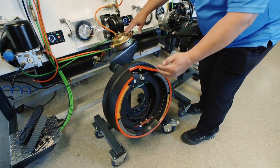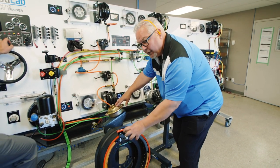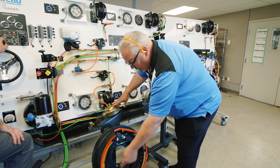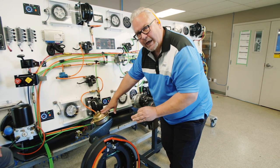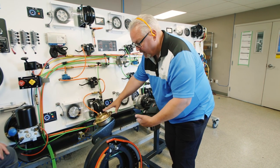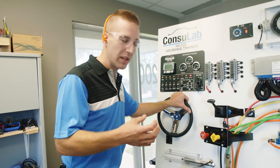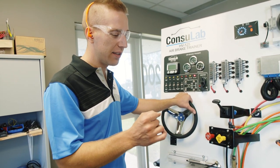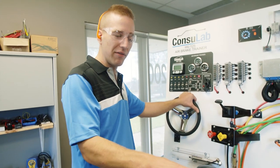So we're going to demonstrate this by looking at the end of the S-cam, and we'll be able to watch the modulation and the physical action within the brake. This is key for the student's understanding of what's going on within the system and in the brake. Let's fire up the truck, bring it up to speed. We're going to put that left front wheel on ice and we're going to see what happens — watch the S-cam, the air brake chamber and everything react.